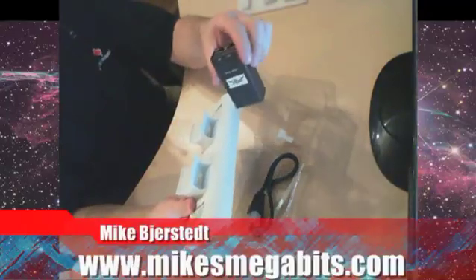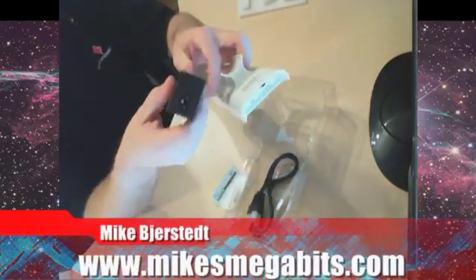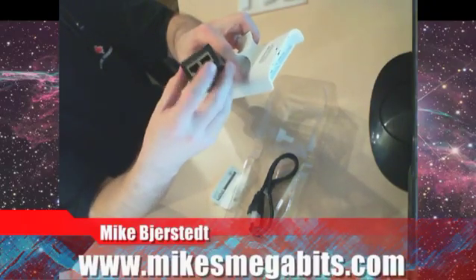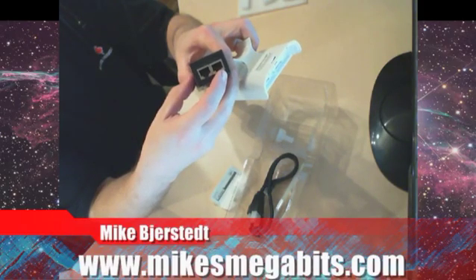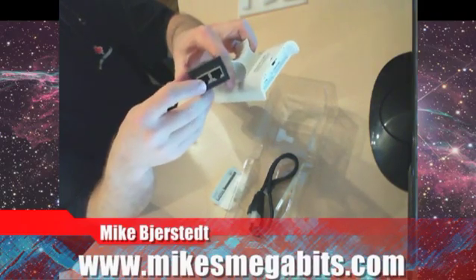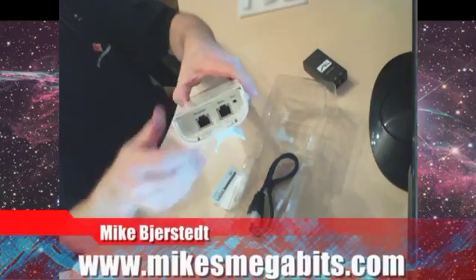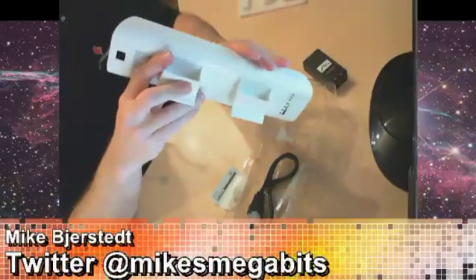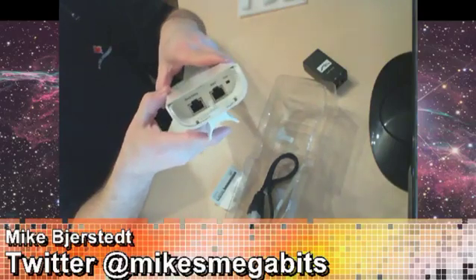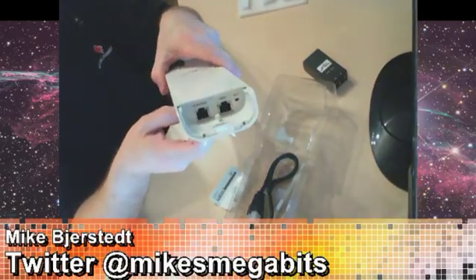The unit works with Power over Ethernet, so you don't have to run two cables — you just run your power and it plugs in to the wall just like you would with any laptop. There's an input for your network, so at his home I'll run a line from his router to the LAN port. Then the power gets injected into the PoE connection and that goes into the plug on the antenna itself. There's also a secondary plug if you want to use a network camera, and you can access that camera across the link. This is like a network bridge, so it would be as if you're on your local network even though it's a couple of kilometers away.